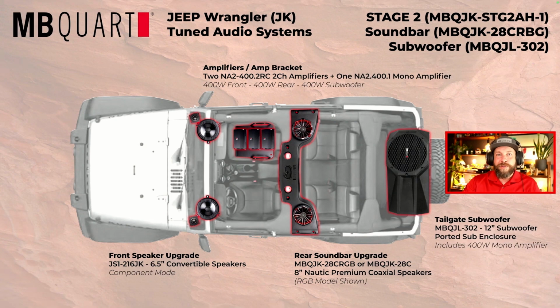So we go with a tailgate mounted subwoofer. This gives you an additional 400 watt monoblock amplifier that bolts into the included bracket on that stage 2 audio system. It has all the power wires from that stage 2, so everything is literally plug and play waiting for you for this subwoofer setup. It includes a ported tuned subwoofer enclosure that's mounted on the rear tailgate of the Wrangler JK and a 12-inch subwoofer. This system performs, man. And it totally wraps up the full range sound of what would be a pretty amazing MB Quart Wrangler JK sound system with that stage 2, an upgraded rear sound bar, and this subwoofer setup.